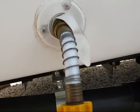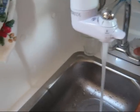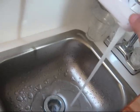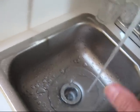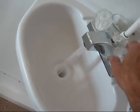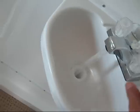It puts a lot less stress on the inside fittings on the trailer. Now you also want to run your faucets after you fill your water tank a little bit to purge the water out of them. One of the benefits of going to 25 PSI instead of 40 is that it doesn't blast out at you — at 40 it's almost explosive the way it comes out. We want to do this for both lines, the hot and the cold water.